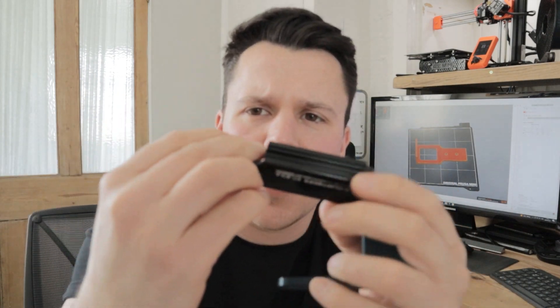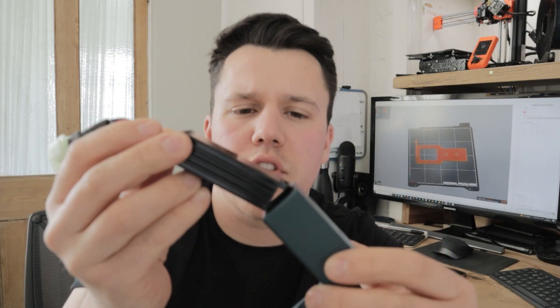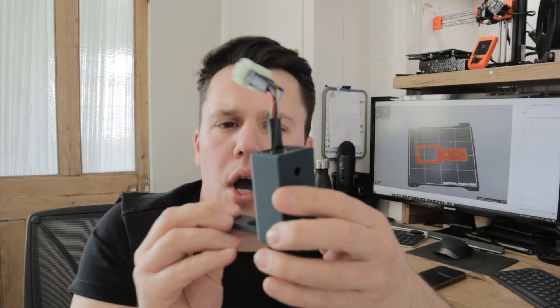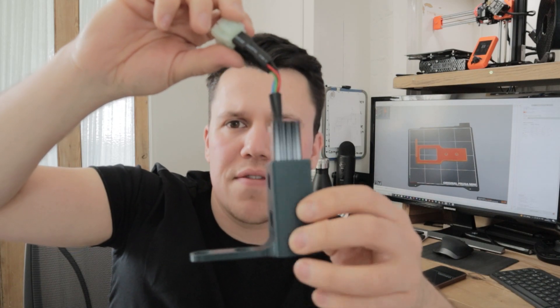The CDI is in this small aluminium box, and this is the first part we've designed. I left half a millimetre clearance on this casing just for a bit of tolerance — it slides in there, locks into the bottom, and then sits like that. For actually holding it, it's quite well secured that way, and there's a harness here. Maybe a slight bit of tape to make an interference fit, or when I go to the final production part, I'll take it down a tiny bit so it's more of a slide press fit rather than a loose fit. Very happy with the first part — let's get the next bit printed.